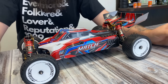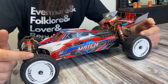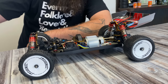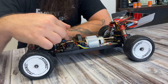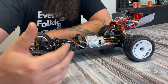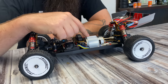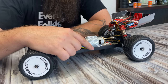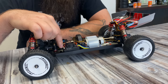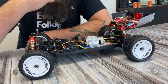So here it is — the 104001. I know that's a weird name. Let me explain: 10 because it's 10th scale, 4 because it's four-wheel drive, and 001 because this is the first version of it. But underneath is where things get really interesting. Inside they've upgraded their ESC receiver combo. It still uses the same transmitter as the other WL Toys products, but that's not necessarily a bad thing — they're pretty decent transmitters for what they are. 550 brushed motor with this enormous heat sink on it. This thing is massive. And we're running what looks to be a normal size servo, but it is still a five-wire servo.